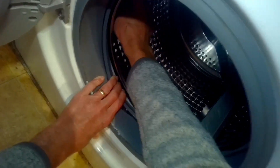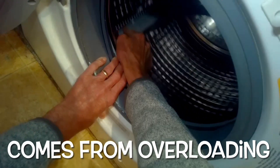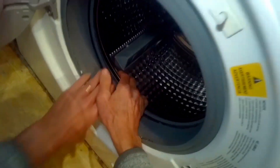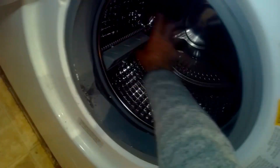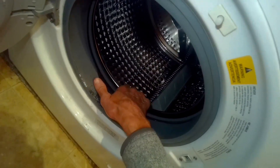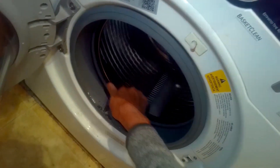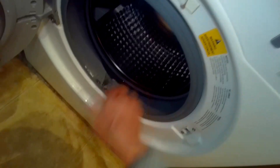When you try to spin it by hand you'll hear it clunking around, and during agitation it'll also have a clunking sound. The bracket on the back broke over time, so that one's really wobbly — definitely a broken spider bracket.